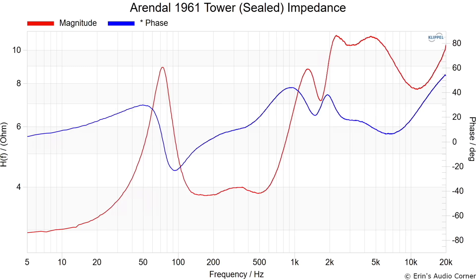The first thing I want to note is the impedance. No issue for an amplifier to drive the speaker, but an AVR is probably going to have problems with it. You do dip below the four-ohm mark through here, and I don't think most AVRs are capable of four ohm. Generally speaking, you're probably going to want an amplifier for this speaker.